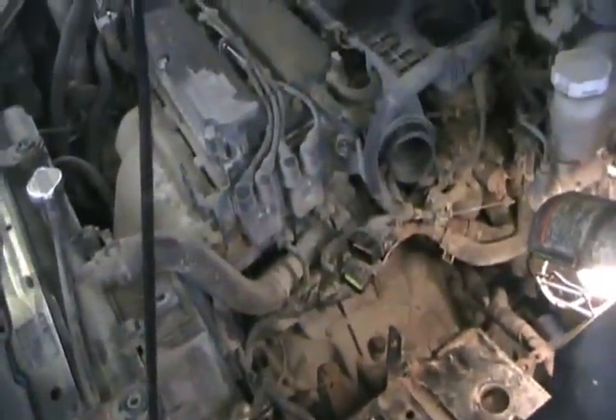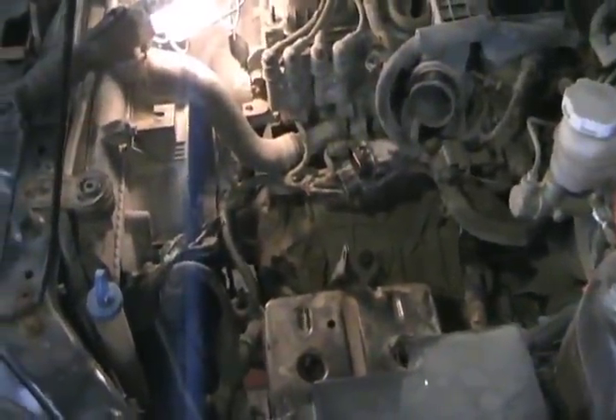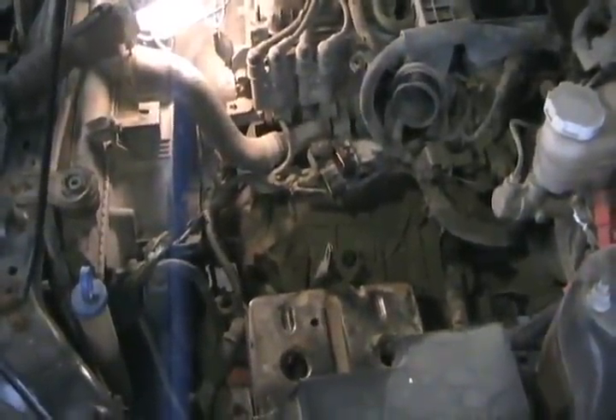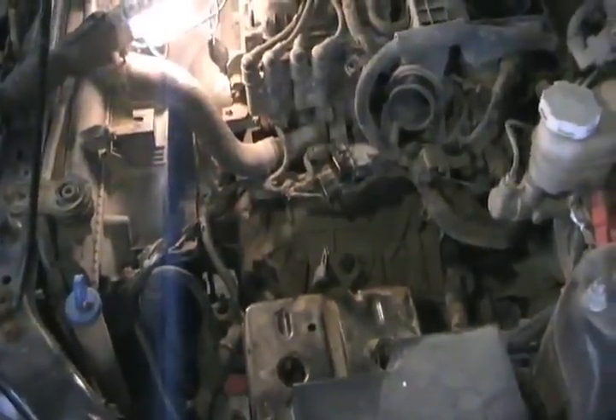There she be and nothing fell. There are two ways to get the transmission starting to come off: one is to go back in the car and push the clutch, which will move the transmission over a bit; two is to get a screwdriver or wedge in there and pry between the block and transmission. A little push of the clutch just gave me a centimeter gap. On most jobs I see if I can get the transmission far enough out of the way to slip the clutch, pressure plate and everything in and unbolt and re-bolt it without putting the transmission on the ground — it saves a few steps.